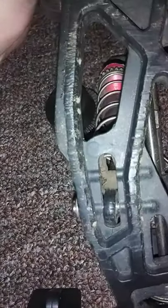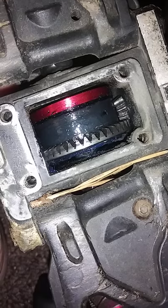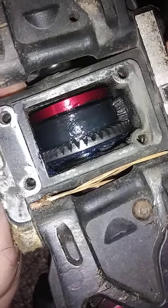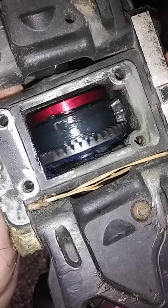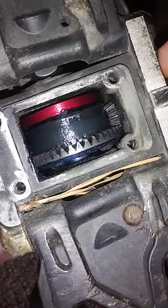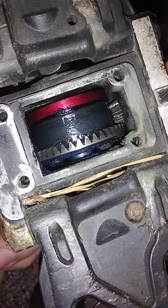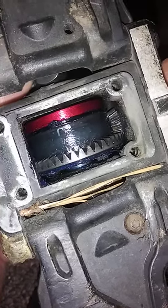And also, if you put it in there and it's feeling rough, you don't want to bring the pinion too close to the ring gear. You don't want to bring it this way too much, or it'll kind of mess your mesh up, won't mesh properly. So you kind of want to get it right. See, I got a little bit of slop in mine right now, which is not good. I don't like getting any kind of slop in there.